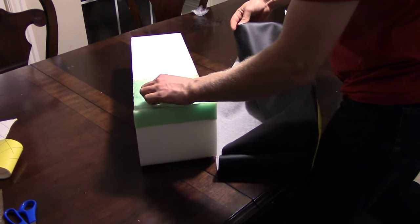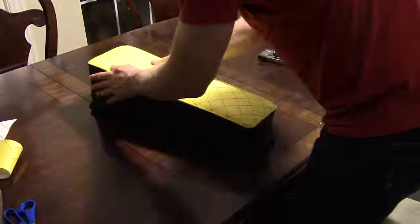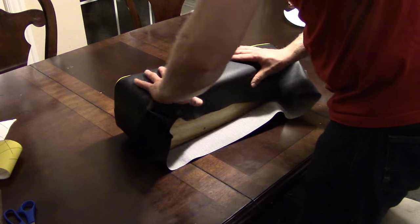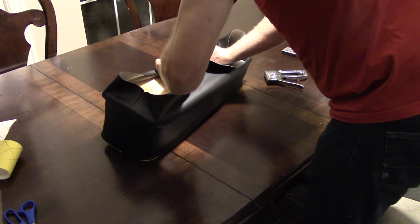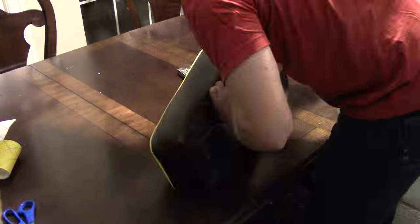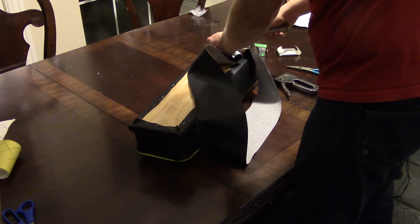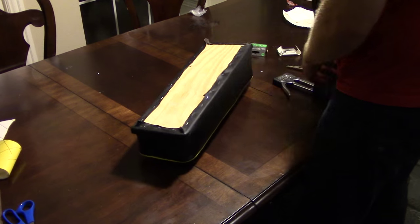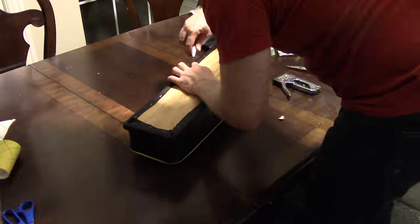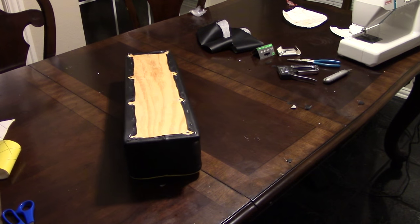There's the padding attached to the board — I just glued it on there. Notice how there's extra padding on the edges; that's very important because you don't want the edges of the board to show through, since that padding does compress. I'm taking the seat and covering it with the upholstery. You do have to work it a little bit, cram it down in there, work it back and forth. Then I'm using a staple gun with standard staples to staple the vinyl to the bottom of the seat. Now I'm using a razor blade to cut off the excess vinyl. I just have to cut a little bit for the areas where the T-nuts go through, and then erase any pencil markings.